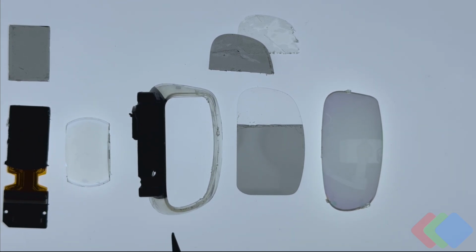This housing actually provides the critical mechanical tolerance that you can achieve and how close you can get the planes of all of your images or all of your rays to the ideal design that you've put on paper. In practice, realistically, you will have to make some sacrifices because no tool is perfect, and we're going to get some distortion in the injection molded plastic that's going to give us a few microns or a few tens of microns of inaccuracy from part to part.